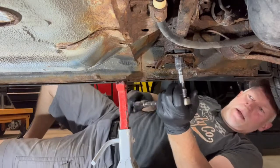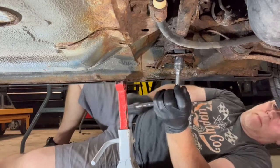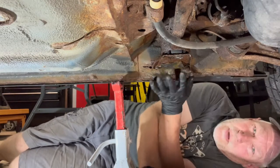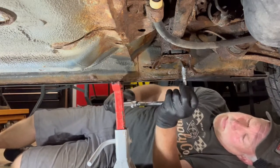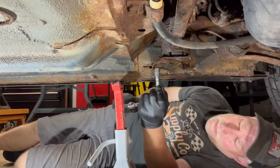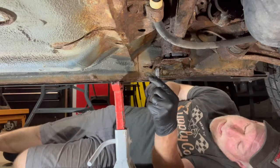I've got a good six-point socket on here to break it free. The bolt that came out of here was a 17-millimeter, and these two I'm going to remove right now are 12-millimeter bolts. They're pretty crusty — I did PB blast them — and I'm a little concerned how these are going to come out, so I'm just going to loosen them up a little bit. I'm not going to take them all the way out; I'm afraid that's just going to be an issue.